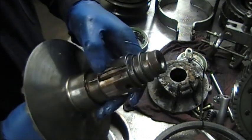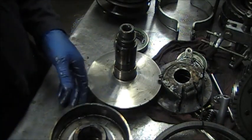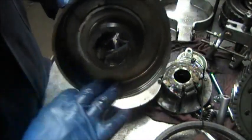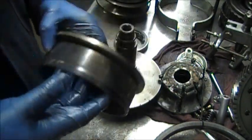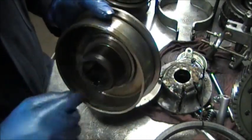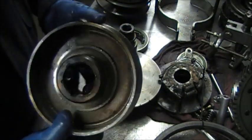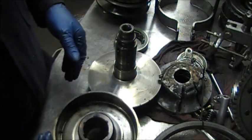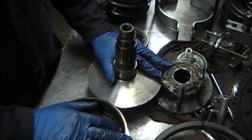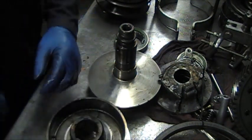This shaft is bad. If it's bad, you find another pulley. Then you look at the inside of the drum — if the inside is scored, it's no good and you need another drum. That's it for this pulley. We will move on to this pulley next time.